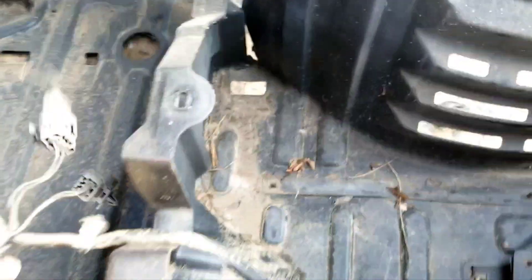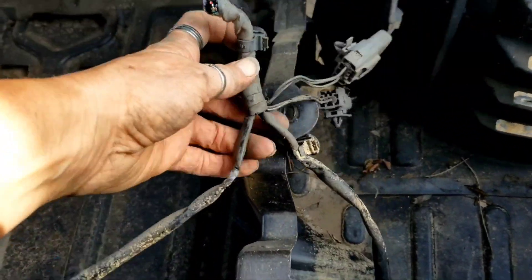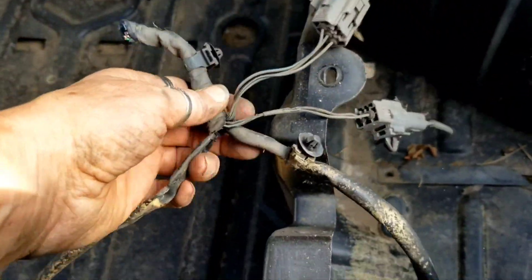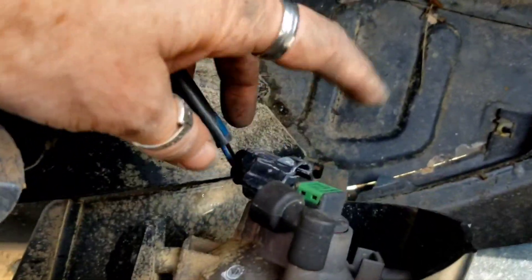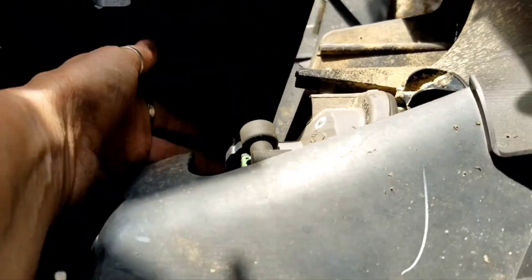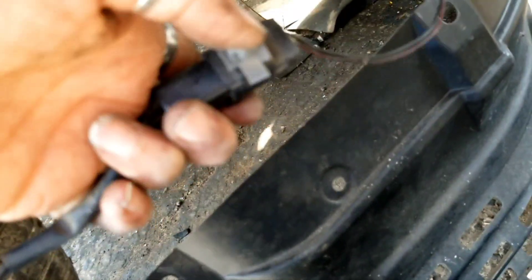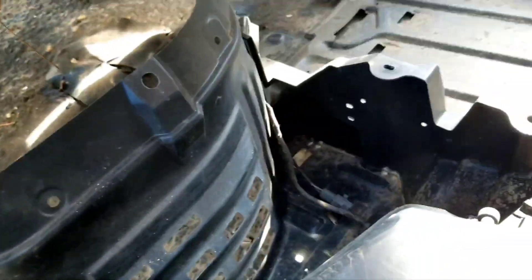All this is one big wiring harness that attaches with these little guys. If you were to unplug this stuff, the best thing for you guys to do is unplug here at the fog light. Again, unplug at the fog light right down here. Just disconnect there. This piece will stay with the body and you'll have your whole bumper.